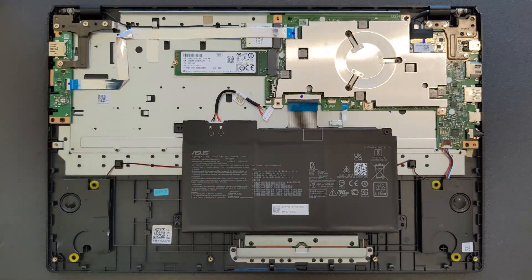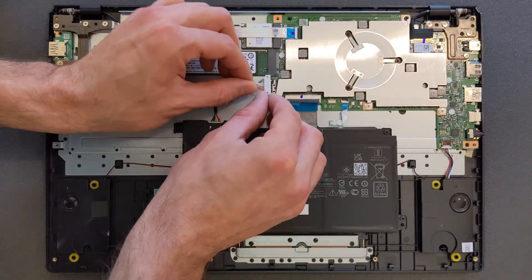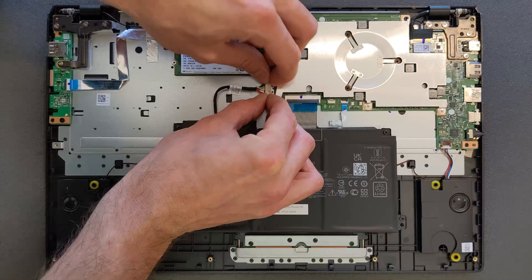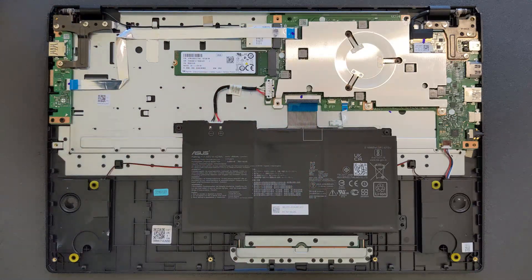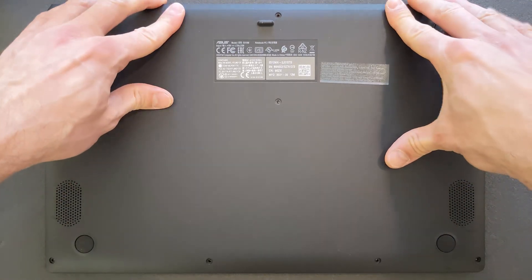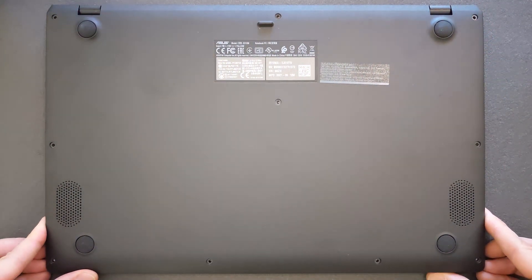The little screw you saw there - the laptop doesn't come with it, you need to find one or buy one. You can connect the battery back - don't forget it. It happened to me quite a few times: I forgot to connect the battery and had to open the laptop again, so I recommend connecting it now. That's it, you can put the back panel back and the screws will go back where they came from. Bad news is RAM is not upgradable sadly - this laptop came with 4GB DDR4 RAM and that's how it's gonna stay forever.